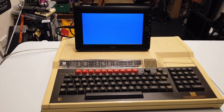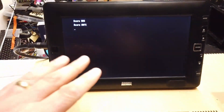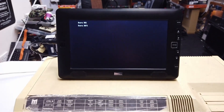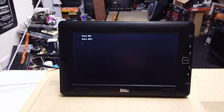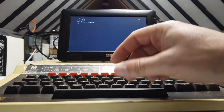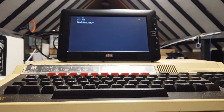Alright, BBC connected to monitor — let's do the reach around and turn it on. Everything seems to sort of work. I'm used to it saying something like 'ready' written on the screen with a colon and a little blinking cursor. Apparently typing on the keyboard does nothing, so a little research says if you hold down the F key and boot, then we get this — and it says 'This is not a language.'